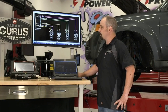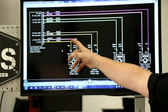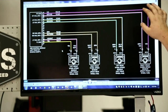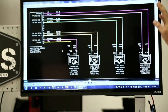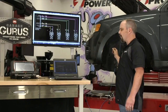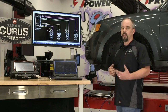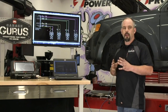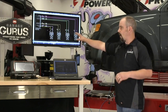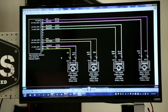I've got the wiring diagram for the Escape pulled up. The left front wheel speed sensor positive is a violet wire with a white tracer, and the negative is a yellow wire. The right front sensor positive is gray and violet, and the ground is just violet. Today we hooked up in the fender well, right at the connector, so it's easy to keep the wires straight. Sometimes those connectors are hidden and you have to go right to the ABS module itself and back-probe there. This module has 46 to 47 pins, so that can be difficult to track.